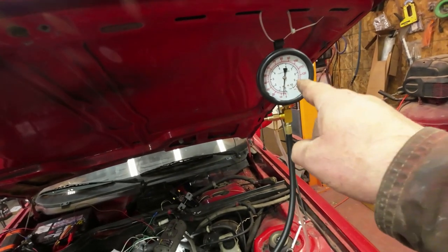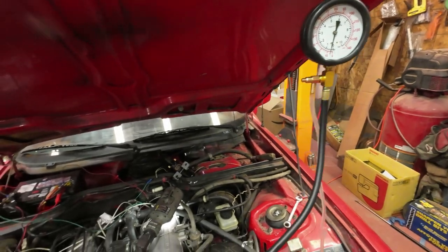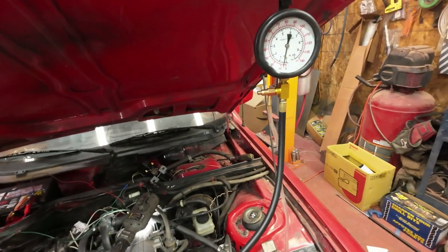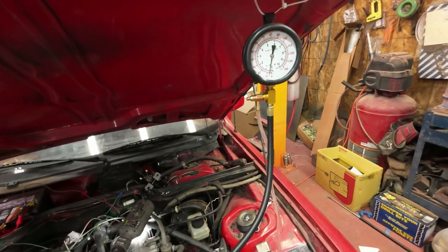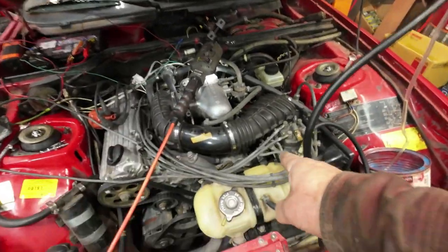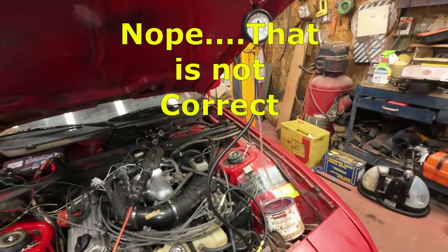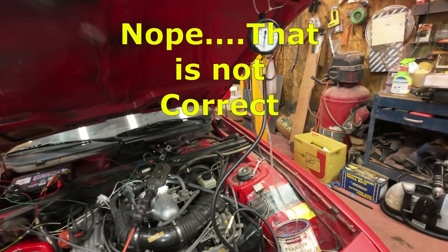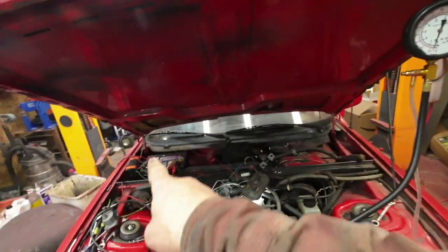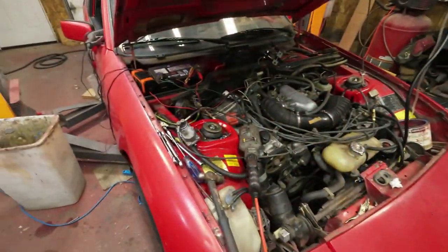Yeah, there now, that control pressure there is proper. So hopefully it's not pushing some fluid into the cylinders right now. Don't think it is, but anyhow, what I had wrong was I needed power to this little solenoid in here. That's a hot start solenoid. I don't know what it does for sure, but I put power to it, and sure enough, everything dropped. So now I can start adjusting this. Yay.